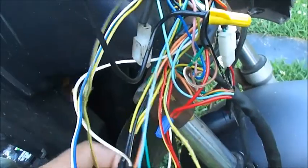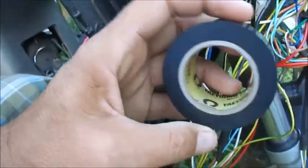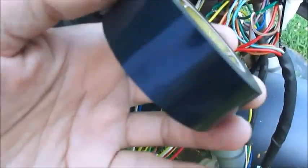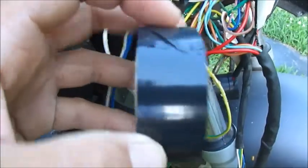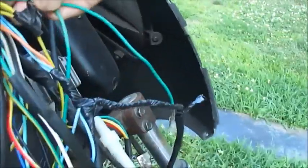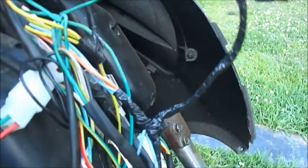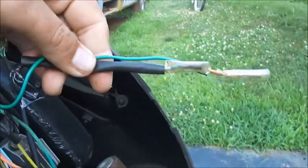This thing had some wiring issues last summer and I didn't get to ride it much, so I've just been going through all the factory wiring and checking everything. I'm using this automotive wiring harness tape — it doesn't have sticky on it — trying to route some wires that go together. But I'm missing a front turn signal, I believe.